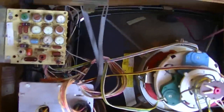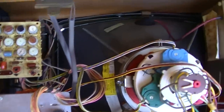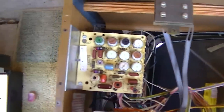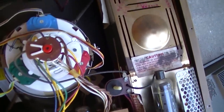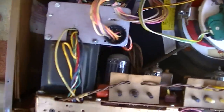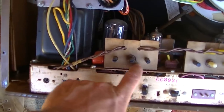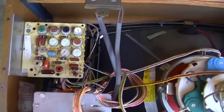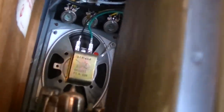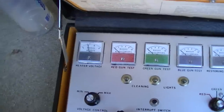Here's number two, and I would dare say number two almost checks out as new old stock as number one. Original horizontal output tube, clean, not a lot of dirt on the high voltage. They were in a damp environment, that's why there's kind of this corrosion-y rust stuff. None of them work because they all got whiskers in these pot assemblies, so the vertical and AGC doesn't work on any of them. This one has the same thing where the speaker lead is knotted around the degaussing wire. Here's a look at number two.